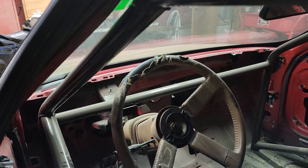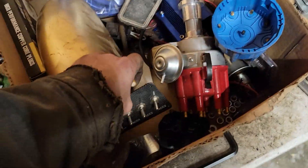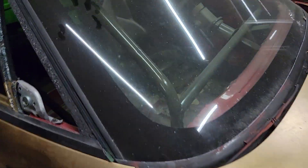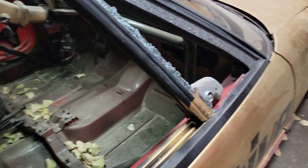I'll probably also hook up the fuel pump, filter, and everything down there and get it mounted and ready. Then I need to find a way to mount my electrical box onto that bar - right here. I've got four holes in the back of it, two on each side, and I'm going to mount it right on the main roll cage bar that goes in front right there. Things are taking a lot longer than I planned, but better to take your time with something like this and do it right - especially when you're doing 120-130 miles an hour in a quarter mile. Better safe than sorry.